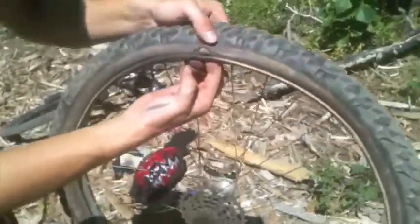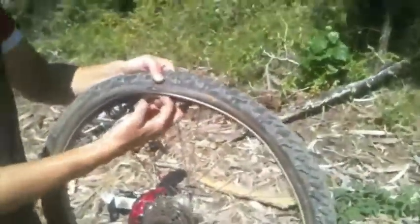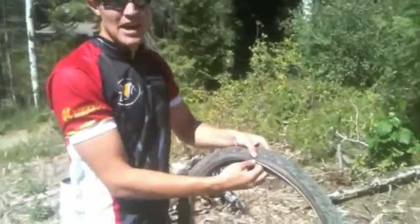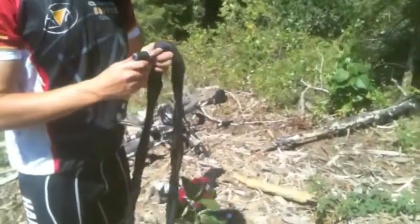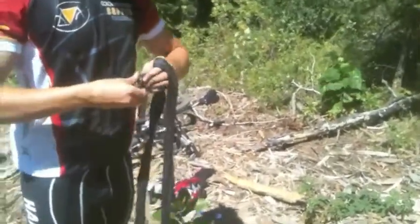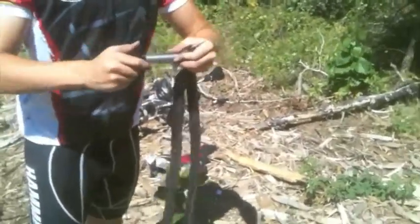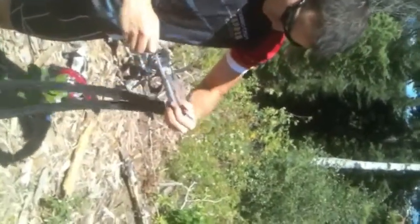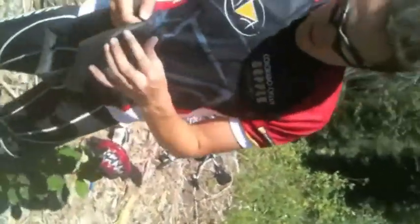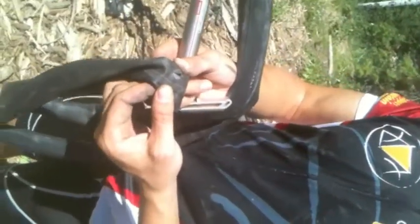So we're back. This is called a blown tire. I don't think either of us have ever seen that in our mountain biking careers, but there's a first time for everything. We're not sure if we can use this tire, so what we're going to do is check the tube and see if the tube will hold air. It's a slow process with a mini pump. There it is — right here. It's like we had a rip. This, good fellows, is not patchable. It can be a puncture, but it can't be a tear. So this tube is trash.